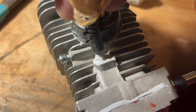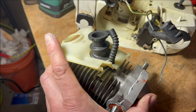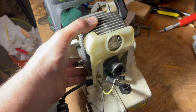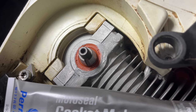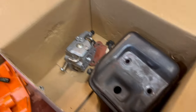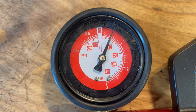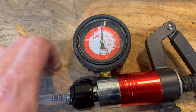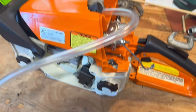A little moto seal under your impulse line won't hurt anything. For this tiny hose clamp, put your heat shield on now because it's much harder later. Slide in your motor. Bolt it in quick before the sealant dries. And we let that cure for 24 hours. Then reinstall the handle, carb, and muffler. Let's see how we did with another pressure test. And now we're holding a steady 7 PSI. Flip over to vacuum mode. And it's holding 7 PSI vacuum also, so we have no more leaks.